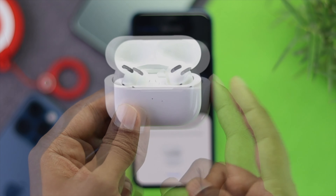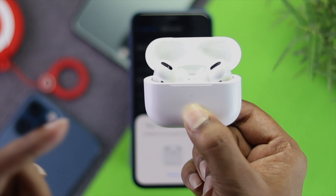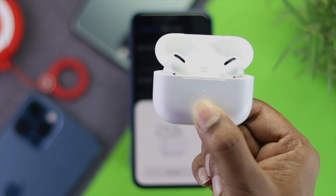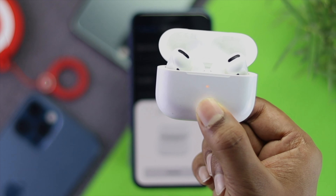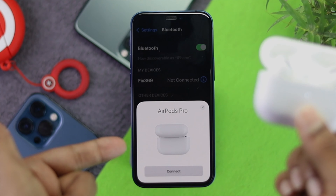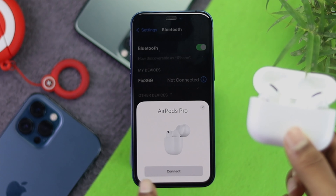To do the hard reset, just get back to your AirPods case. Simply open up the case and press and hold the button on the back. Press and hold it for some time until you see the light change to a red or orange color. Keep holding for some time, and after you see that color pop up, you'll be able to see the pop-up come on your iPhone. You'll then need to set it up all over again.